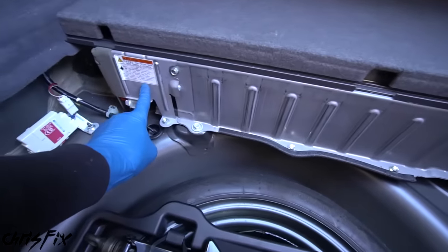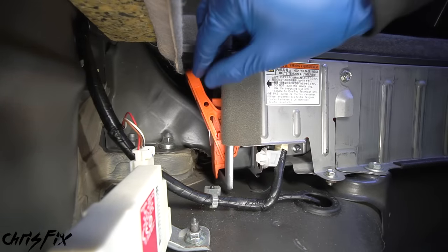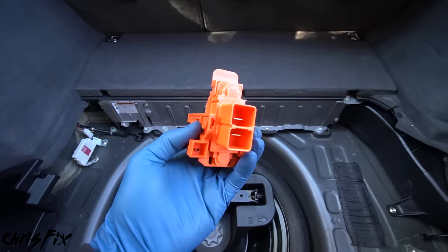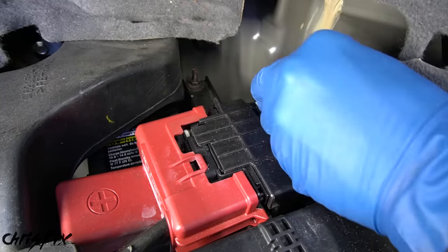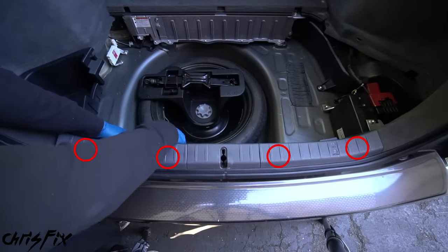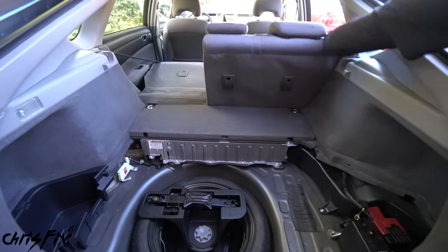We also have a torque wrench to get all the bolts tightened to the right spec. That's all you need — no special tools. To get access to the hybrid battery, we go through the trunk; the battery is located right behind the rear seats. The first thing we want to do is make the battery safe to work on by removing the safety plug, which can be found under the carpeting. Start by removing the trunk floor mat, pop out the privacy cover, then remove the trunk floor, the driver's side bin cover, the large storage bin, and finally the 12-volt battery cover.